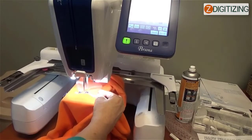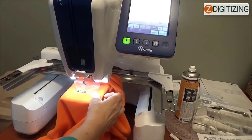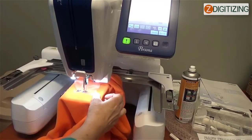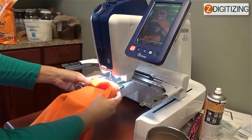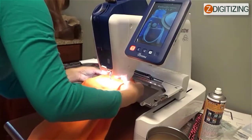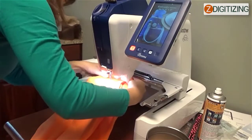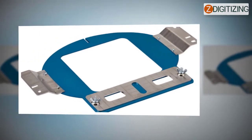Number six: the carriage moved while removing the embroidery frame. The design might become misaligned if the presser foot was hit or if the carriage was moved while changing the bobbin thread, changing the needle, or working near the embroidery frame. Be cautious when doing so. If the carriage is moved, turn off the machine and then turn it back on again. The right position of the frame at the time the machine was stopped is stored in the memory, and the embroidery frame will return to the right position.